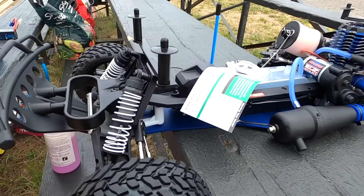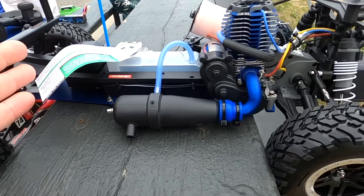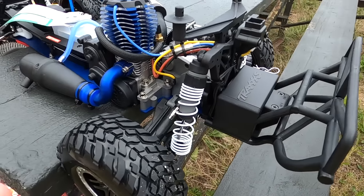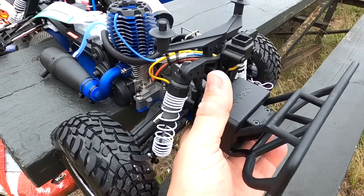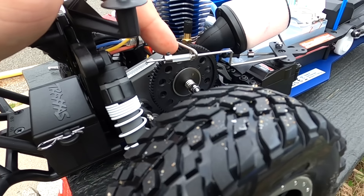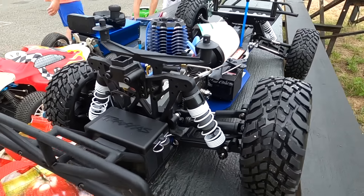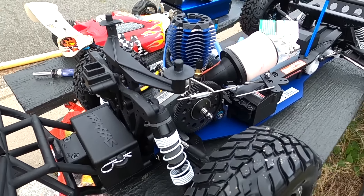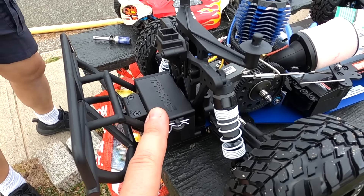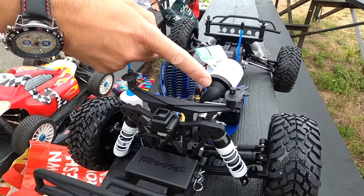This chassis is essentially kind of an extended Nitro Rustler chassis. There are many elements here that are interchangeable with the Nitro Rustler, which is very good for parts support. These are single speed transmissions with slipper clutches and yes, they will hit 50 miles per hour. Have you checked whether there's a battery pack in the back? I tested — the brakes work and the throttle works.